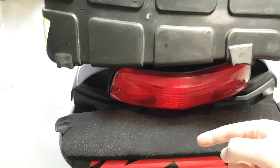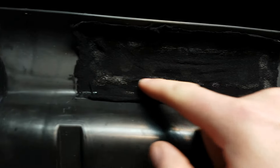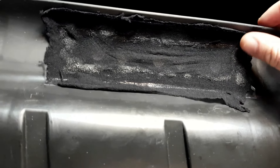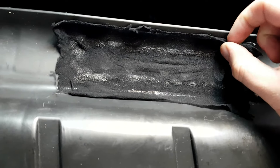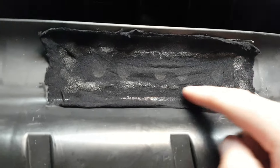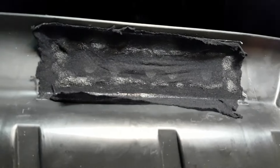Now I have to keep an eye on this, because if I'm not keeping a close eye on it getting all clogged with belt dust, I could find myself in a bit of a situation. So this is a risky maneuver in a way. Neither of these are going to prevent any water from getting in because it's the cheaper stuff. But I would argue it's a must-do. Here's how I did it: two-way tape on the outside, and on the inside I put a bead of silicone. I wasn't sure what was going to stick the most — two-way tape won't stick forever. The last thing I want is the fabric or the tape to get sucked in. So having silicone around the inside means that even if the two-way tape comes off, nothing is going in.